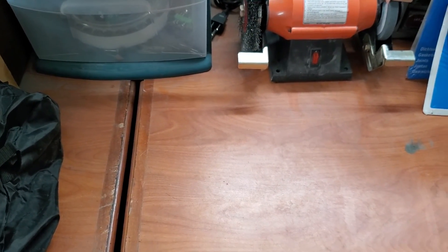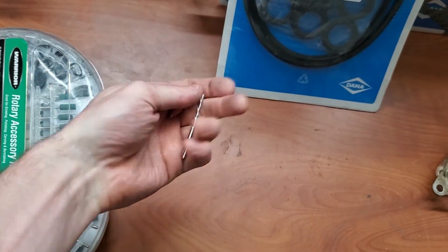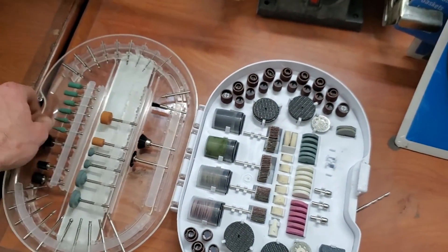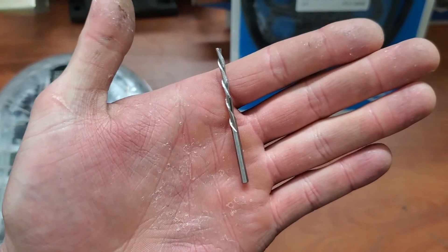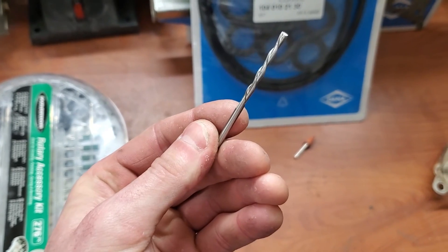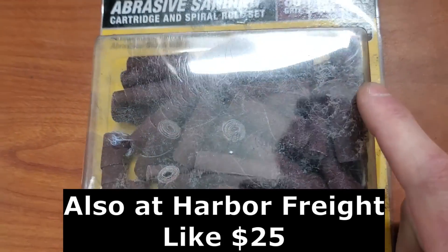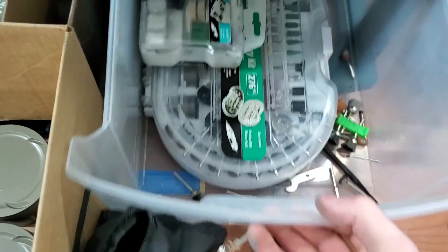For this we're gonna need just a couple of things to start off. You're gonna need these two bits. This one comes out of just a rotary tool accessory kit — I got this at Harbor Freight, it wasn't crazy expensive. And then also one of these — I got this at Home Depot, I'm sure you could find it at Lowe's in the rotary tool section. This is called a multi-purpose cutting bit and it's pretty good at removing aluminum. And then we're gonna be using these abrasive cartridge and spiral roll set — they're just like these sandpaper cylindrical cartridges. It comes with this mandrel here except I had to modify it a little bit.